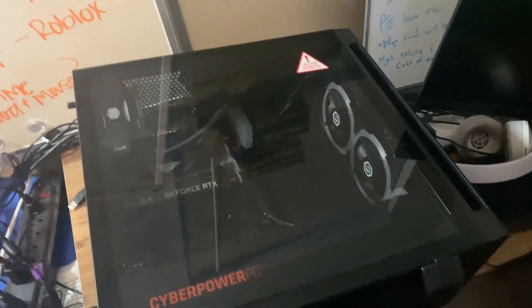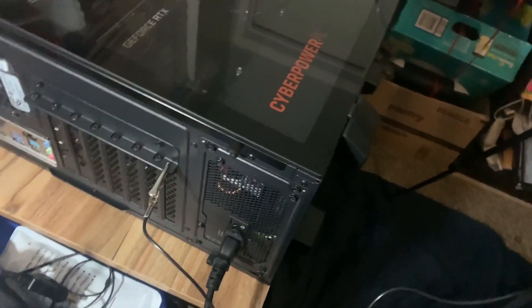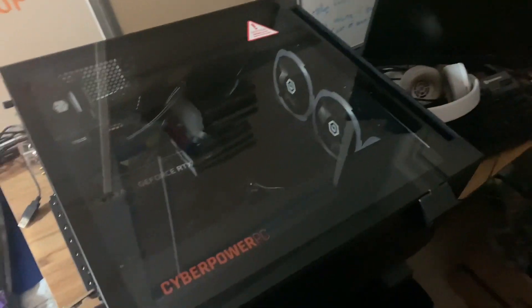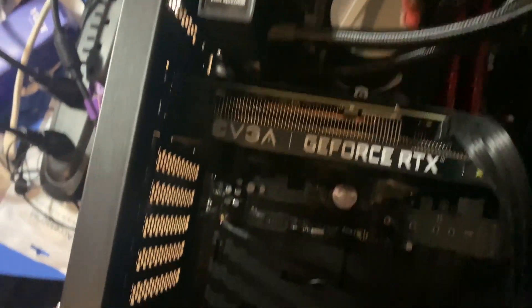We got the PC laid down. We also have our wrist wrapped. We're going to clamp that to the metal part of the PC to ground us. Couldn't get a strap, so I made my own — basically some aluminum foil around a rubber band with an alligator clip connecting me to the metal part of the PC, so I can be grounded and don't short anything inside.